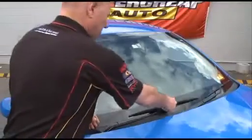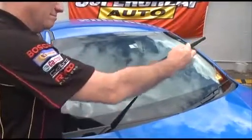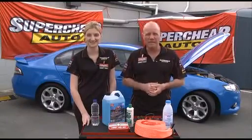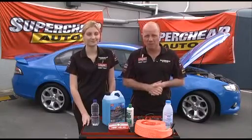Check that your wipers work and that the blades aren't split or perished. If they leave a smear across the windscreen, you need to replace them. On the open road you will get bugs and grime on the windscreen, so make sure your washer jets are pointed the right way and that the reservoir's full.